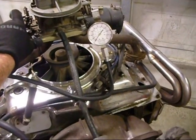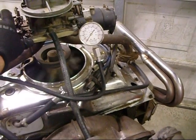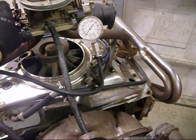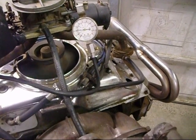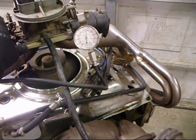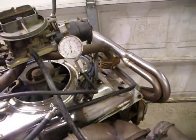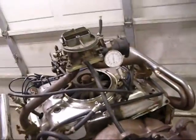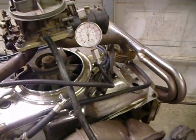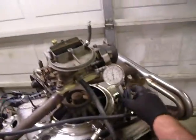This thing's got some teeth missing off the flywheel, so the starter only catches once in a while. So now you saw that needle move — it's about 145 PSI. You want to keep cranking it with the throttle wide open until the needle stops moving, and that pretty much tells you where you're at. That one looks like we're at about 145 PSI, so that cylinder's good.